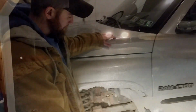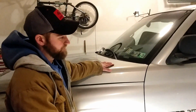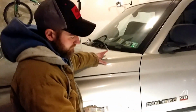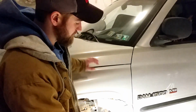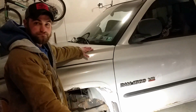What's the easiest way to pack? So now we're gonna try to at least get the bed off yet tonight? Yeah, I'm gonna try and break those 3 bolts loose on either side for the bed, and then disconnect that wire and disconnect the filler hose there, and then we gotta empty out the bed because I forgot that I have all of my scrap metal and stuff in the back. And then hopefully we can get all those bolts off with no problem. Pull that off, and then if we still feel up to it, maybe try and loosen the bolts for the body and get the body secured, maybe an inch or 2 off the frame for right now, and then we'll call it a night. Sounds good. Let's get to it.